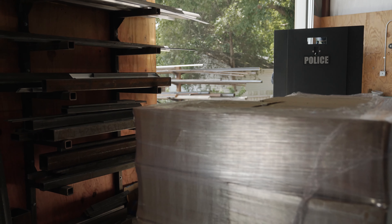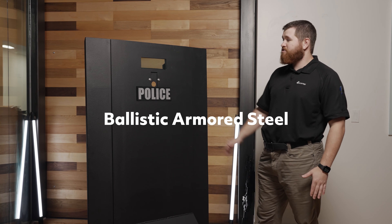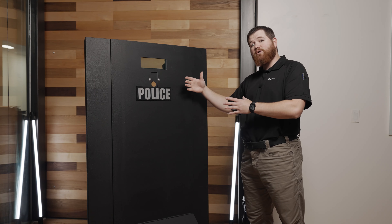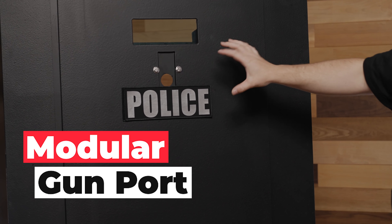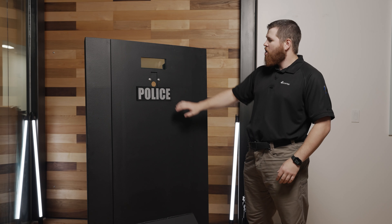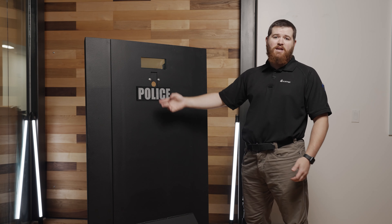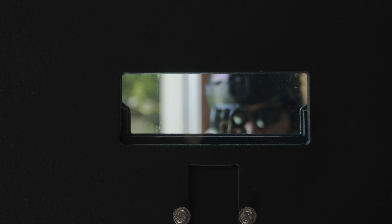Let's run you through some of the basic features of this thing. Obviously, ballistic armored steel — this is customizable to whatever level of ballistic protection you need, along with a ballistic glass capture. This viewport is where the driver, if you will, is going to be looking through as he drives and or shoots through our gunport. The gunport is designed to be modular so that we can size it depending upon whether you're using iron sights, different height optic mounts, different designs for your rails and muzzle devices. This is reversible right now — you can go from a high mount like a 1.93, flip it around and it gives you lower third or absolute co-witness heights. We can also customize that to fit your muzzle devices — if you're running suppressors, whatever it may be, that's completely modular and customizable.